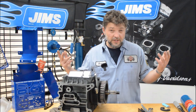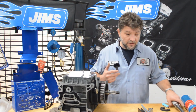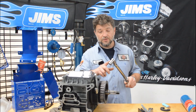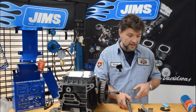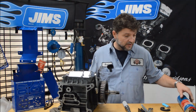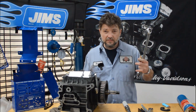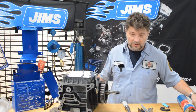To remove the bearing race, you really only need some very basic additional tools. You'll need a three-quarter inch socket. I like to use a torque wrench, and I'll explain why in just a second. You'll need a propane torch, and either an inch-and-a-sixteenth open-end wrench or a crescent wrench.